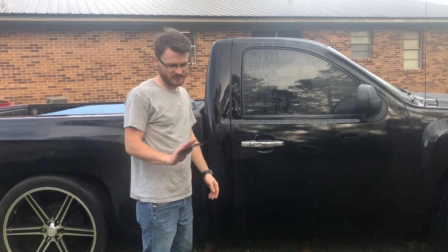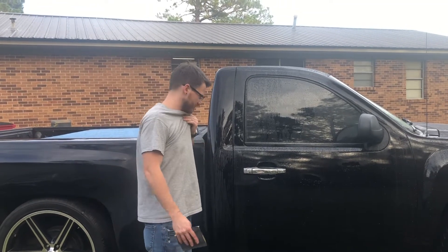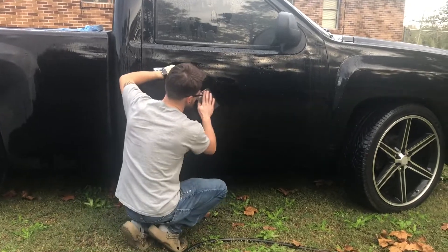So showing how I'm cutting and buffing — I'm taking some 1200 or 1500 grit, and what I'm doing is just sanding down the high spots. You can see the different little ridges and different color in the paint. You can see the shiny black underneath — just slowly sand it until it's just solid gray. You still see a little bit of the specs right there; that's what you're going for, that solid gray, where you know there's no orange peel left.